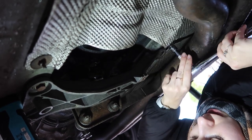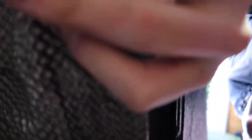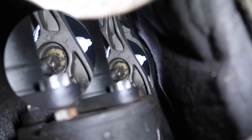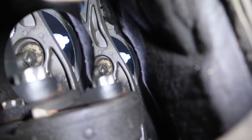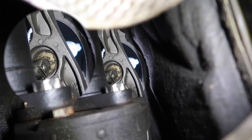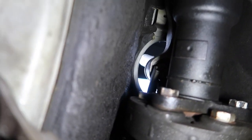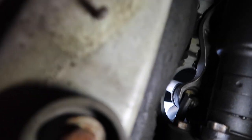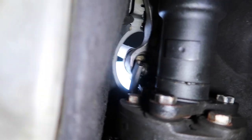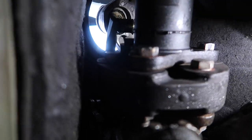I'm going to take this off first. Okay, so now we can bend this back somewhat to access right there — we need to access in this place, it'll be very difficult. Do you see it? It's right up there. You can see the gear stick from here. That's the clip that we have to pop out; there should be a washer there as well that we have to take off. And then this rod over here has to pop out to the right. We have very limited space to work with.